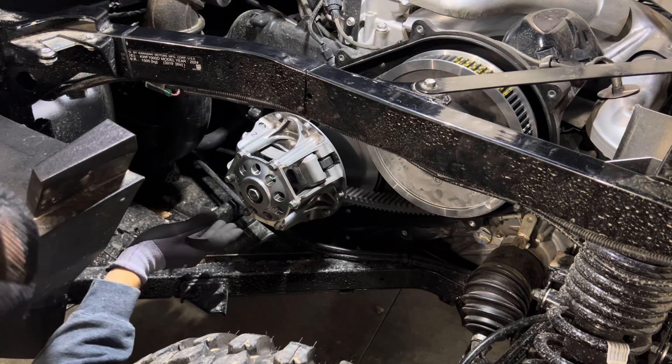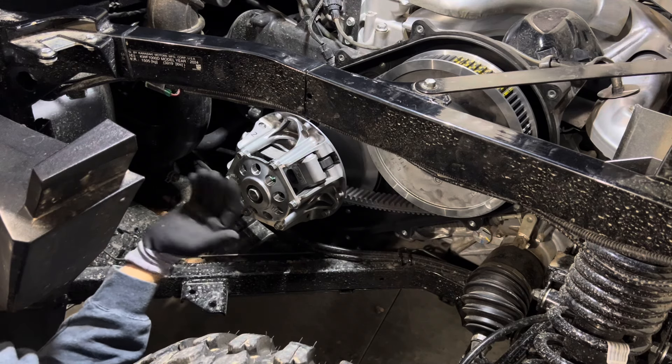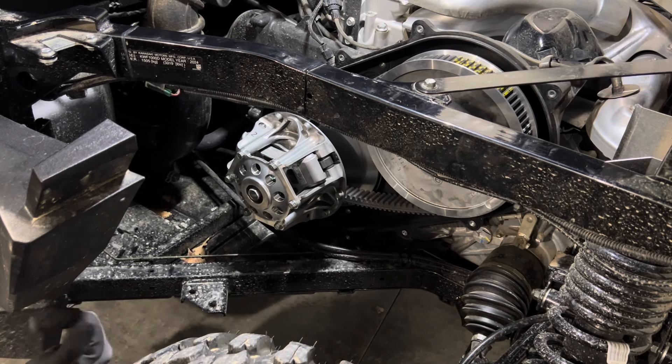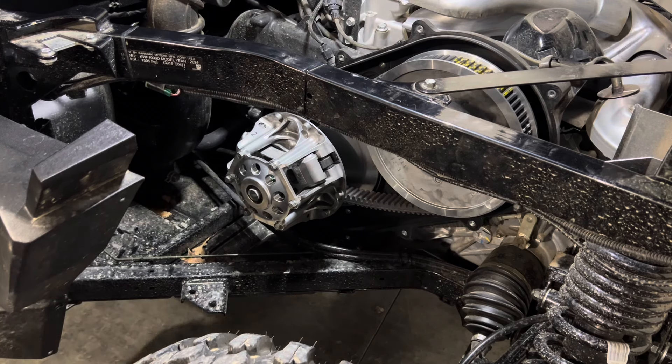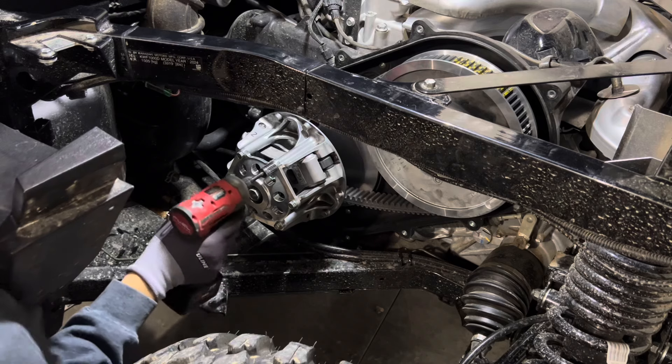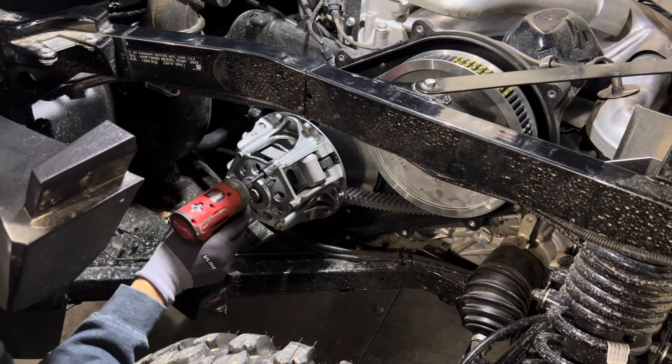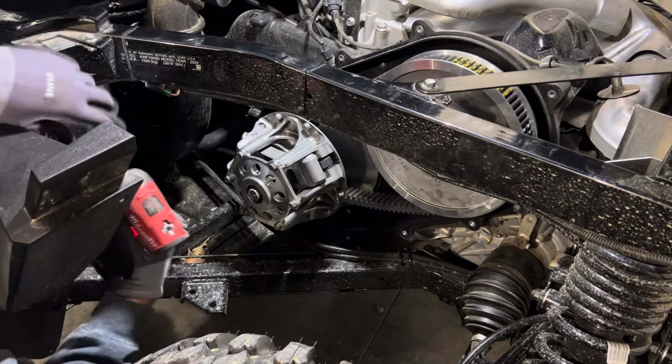The washers are a cheaper way to do it — they work but it's not the right way. We offer them because some people might want that option; it's a way to get a really good clutch kit that transforms your machine. So we're going to pull the cover. We have our primary spring in this — it's already got our weights in it but it's the same process. And this is actually a 12 millimeter, not 13.